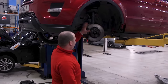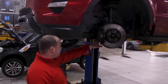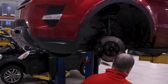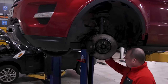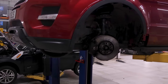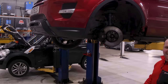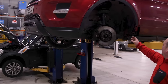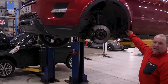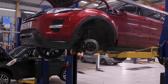Michael's just built up all this front end off the guy who crashed it. The new bottom arm's on, drop link's on, tie rod, track rod end, the drive shaft's all been rebuilt — because we couldn't actually get one on back order at the moment. This is all ready to go apart from the inner arch to go in there. That's probably the worst thing to fit ever — that has never fit. And there's also a piece of trim missing here, so we'll just bend that bit of bracket back out. There's the trim — do you want me to give you a hand with this?